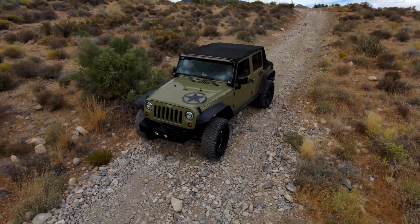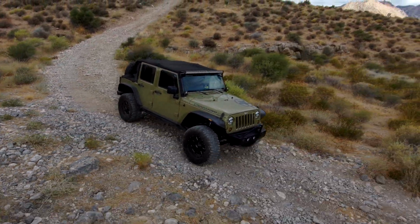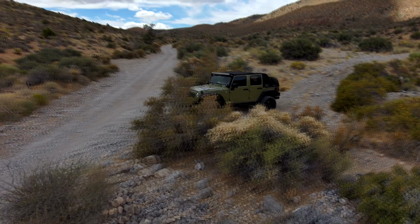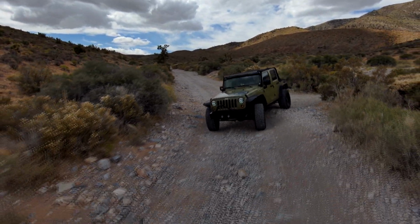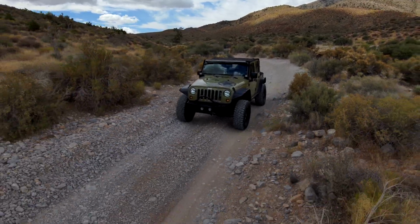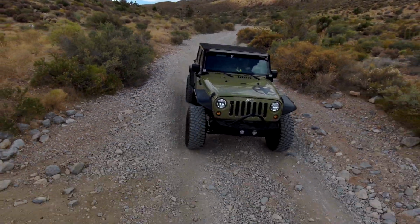Whatever's required, put on. Now, with some builds, we do add additional coolers with fans that are off-boarded, and we have switches. Other ones, like on LT4s and 5s, when you turn the vehicle on, the fans will just come on. We found like the intercooler pumps, we were controlling them through the computer, but I really like just turning them on, because the cooler the intake temp runs, before the blower and after the blower, the more power it has, the more response it has, and all that. So we change up how we control these fans, really based on the need.